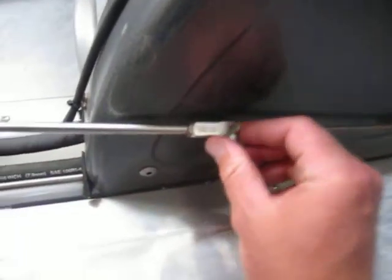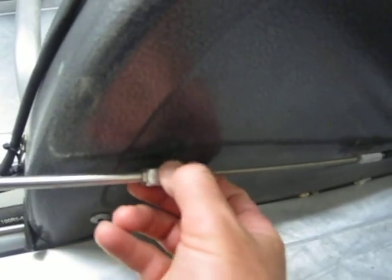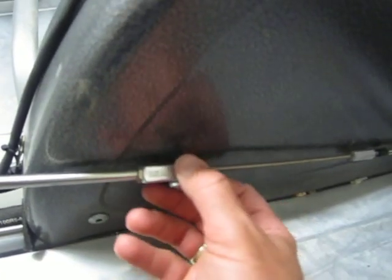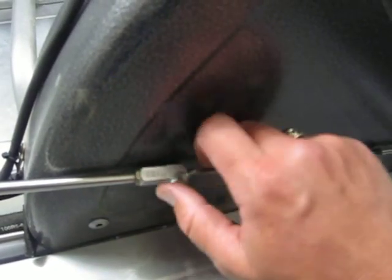One of the key things is you're going to need this cable adjuster right here. So this little wing nut here, you just loosen it, and then as the pedal slide assembly moves forward and backwards, this whole slide will move — you can see how that's moving as well. You want to make sure you tighten it up when you're done.